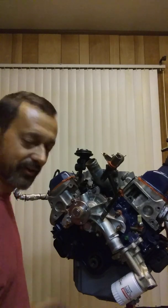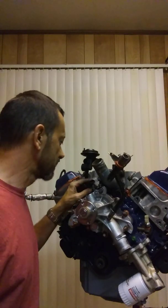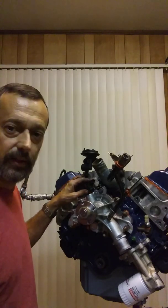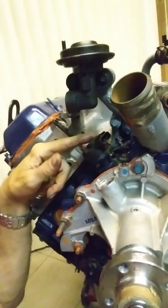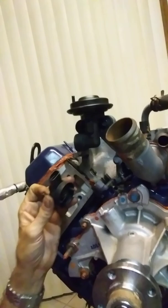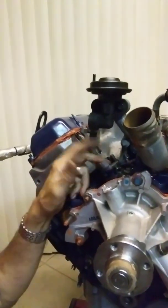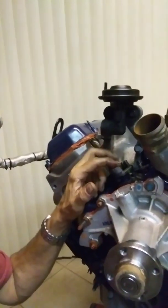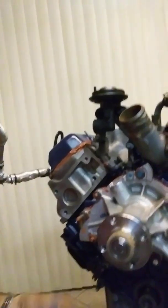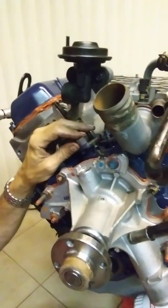In order to do this operation we're going to look at, you're going to have to make sure you get it at top dead center first. So, an important tip: if you're taking one of these apart, when you take this thing apart, this little deal right here — there is your camshaft position sensor. I've already pulled the screws and we'll lift that off. Basically, it's a little hall pickup type thing. Your camshaft drives the gear on this, and maybe on an older version of this engine, this is where the distributor went. This is a lot like the distributor setup we used to see on older stuff.